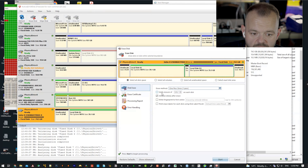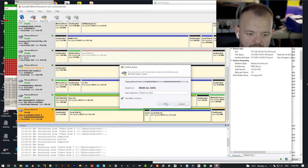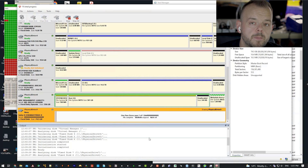You can also verify after wiping, initialize the disk when done, or write a fingerprint to the first sector. Just hit Start — but make sure you select the right disk because if you wipe your system drive, I'm not responsible for that. Type in 'erase all data', confirm. This is the 80 GB IDE drive. Hit OK and now you can see the light is in progress — it is wiping the drive. When it's done we'll open the drive in a hex editor and look at the sectors.